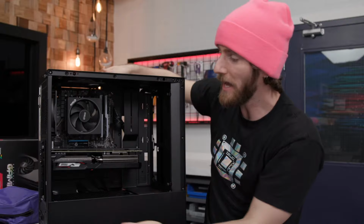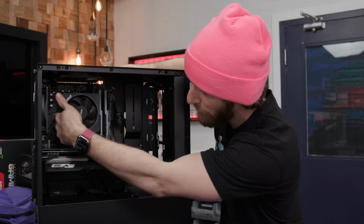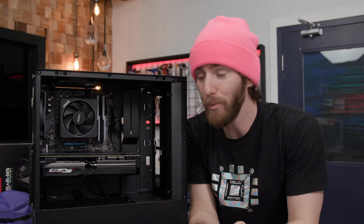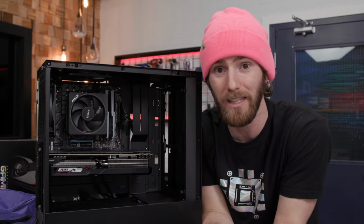If you have a network port here, or if you have a network port here, it doesn't matter. It doesn't matter whether the wires go to your CPU through the motherboard or whether the wires go to a slot and then through your motherboard. It's the same thing. This was a big problem with gigabit networking. You would have a gigabit network port on the back of your motherboard that is connected via the PCI bus, which means that it wouldn't be able to actually reach its peak performance. So it was a big problem.